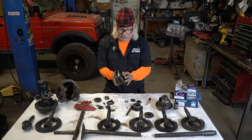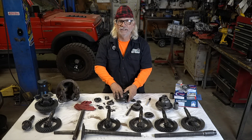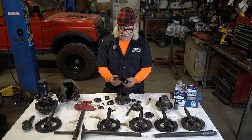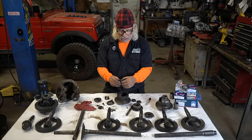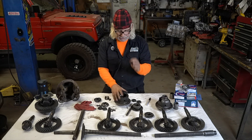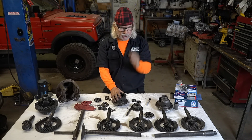Inside the carrier you can see your first side gear. The side gear always has a thrust washer on it — always. Do not run steel to steel, whether you're doing a locker or not. Your short pins are for two of the spider gears, and each spider has its own cone washer. If you're removing this to put a locker in, zip tie that spider gear to its washer — you don't want to mix up the washers and spider gears. This carrier has the same bolt pattern as all of the Sidekick front IFS differentials.